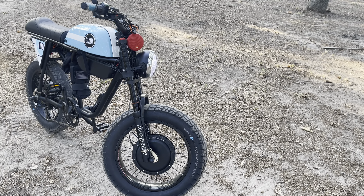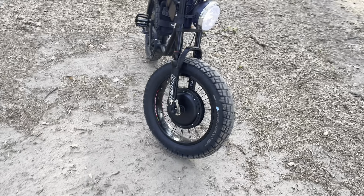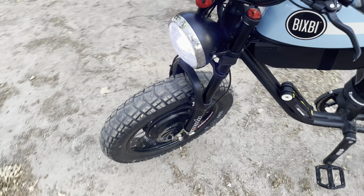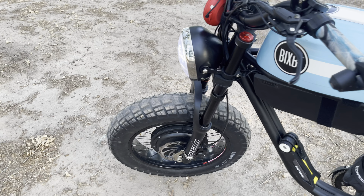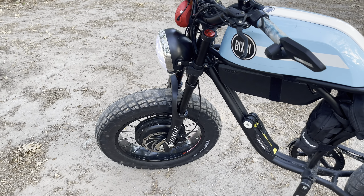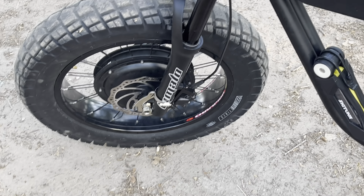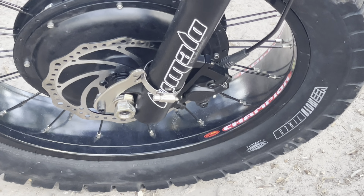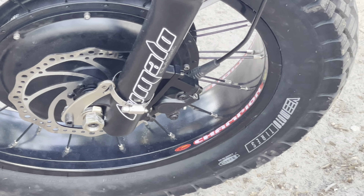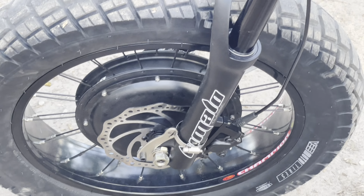After all that, got everything together and it was spinning really pretty good. Then I went to put the brakes on — they're post mount and the original was side mount, so the brackets are different. I had to order a bracket because these are 180 millimeter and it was set to accept 160, so I had to buy an adapter to go from 160 to 180.